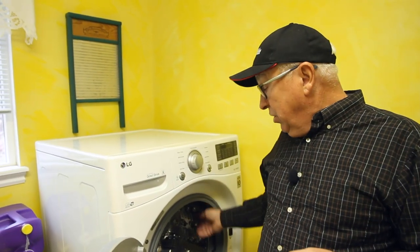One last point: back to the amount of detergent. This was a theme that came up over and over again. A little bit goes a long way. One industry professional suggested you can test whether you're using too much by running a load of clothes without any detergent — if you see a lot of suds, there was excess detergent left in the clothes. He uses no more than a third of a cup, maybe a quarter cup of dry detergent. You can also run the machine empty and check for suds, which would indicate soap buildup in the nooks and crannies.